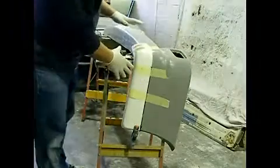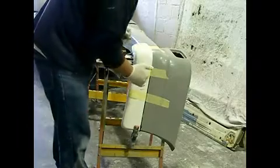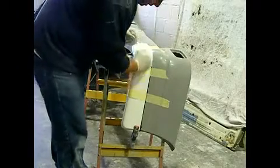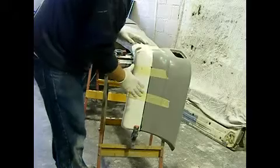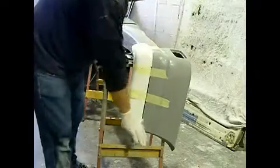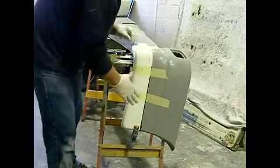Okay, just to update, as you've seen I did put a couple of more bits of tape on it. Couldn't get another clamp on, but it's not a problem because it's all sitting fine anyway. This PU sealer, you can, if you want to, smooth the edge out with your finger and start cleaning it away. It will wash down with a bit of cellulose thinner, so you can just run your finger through and then wipe it down with thinners to take a lot of the waste away.